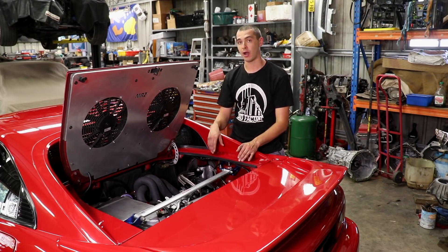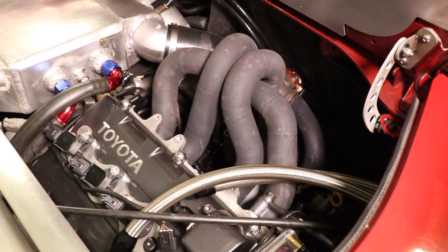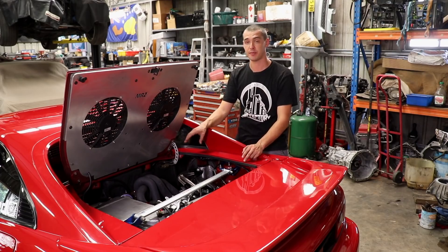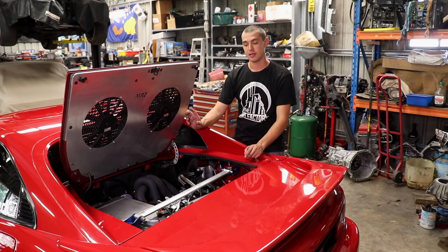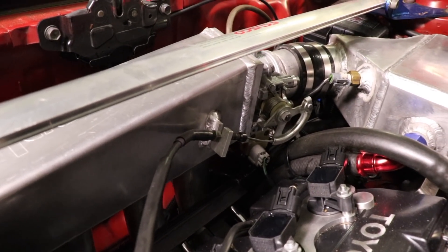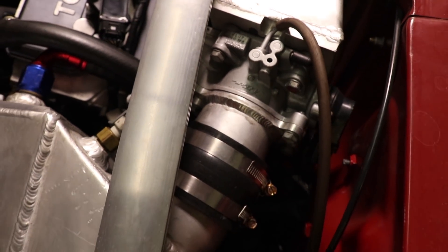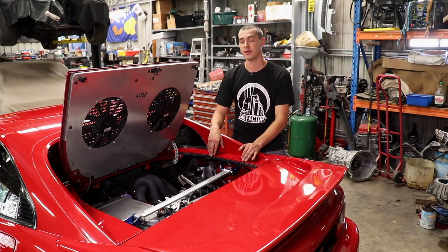I got the car here at The Skid Factory a few years later after Matthew accumulated all his parts. The engine was built here by myself and I threw on the rest of the parts. The turbo setup which Al had already done, intake and everything, was still exactly the same. There was an inlet manifold which Matthew also got from the States — it didn't quite fit, so we had to do some chopping and changing, but it ended up being an advantage to move it into the right spot to suit the water-to-air intercooler.